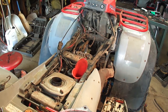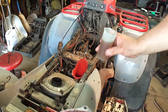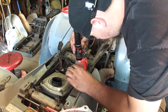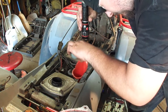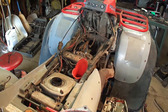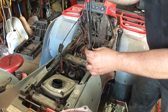Right now is a good time to fill up the counterbalance case and check for leaks. I've got the dipstick out and I've got the funnel shoved down in the hole. I'm going to put 100 cc's of fluid in there — that was 10w30. I'm going to let that drain out of the funnel and then we'll check with the dipstick. A long pair of needle nose pliers will be your friend here.